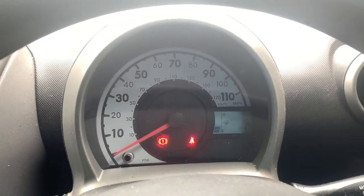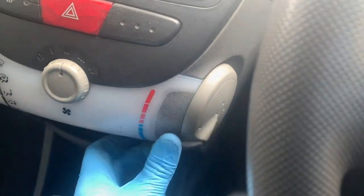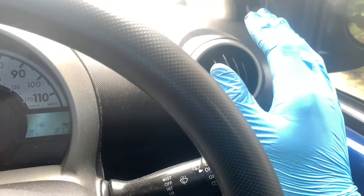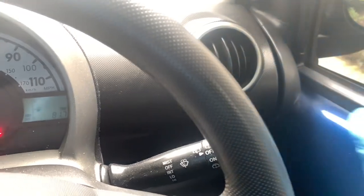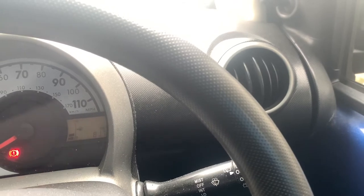Right, and there we have it with new coolant in. And I can't go anywhere because some knob has parked some shit Volvo in front of me. But that van's quite nice. Anyway, not really noticed much of a difference, but when I put it on hot, it goes hot. Now when I put it on cold, it used to be between warm and hot. When I put it on cold, that's cold. So it's not a particularly hot day today, but this has always seemed to let a bit of water into the heater matrix, even when it's turned on to cold. So maybe it's dislodged some shit, that's fixed that valve shutting. Don't know for sure because I won't know until it's a hot day.